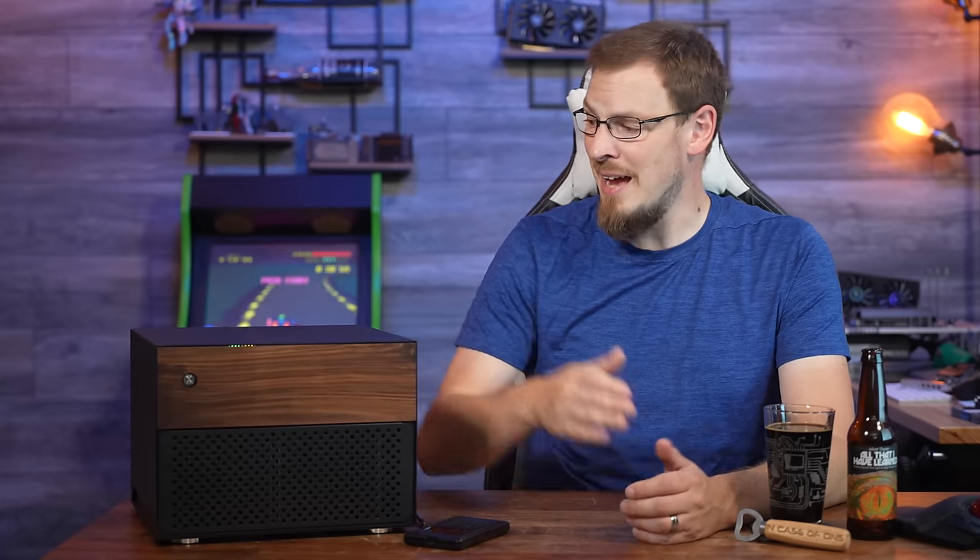There were a number of comments in the build video asking why I went with this particular SATA controller rather than a tried-and-true server HBA. The answer comes down to how I wanted to use this card and the slots available on the motherboard. We're going to virtualize TrueNAS, which means the VM needs bare metal access to all of the hard drives via PCI Express pass-through. The ASMedia 1064 only requires a single 1x PCIe slot, whereas a typical server HBA requires x4 or even x8. Since there's only one x16 slot on this motherboard, and I'd like to leave it reserved for 10 gigabit networking later on, I was forced to use a 1x card only. For a $1,000 virtualization and storage server, I think the results are going to be pretty fantastic.